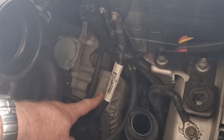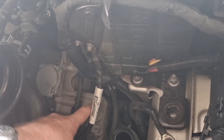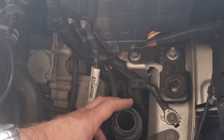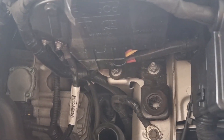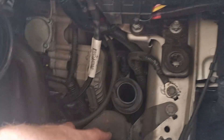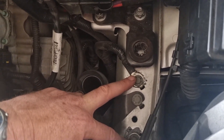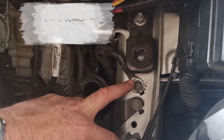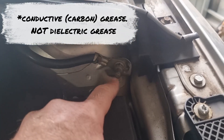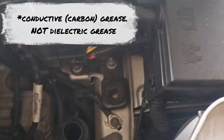This is the TCM here. There's a 10mm bolt there and the equivalent underneath as well, but there is a bit of a tricky plug on here. This is a resonator that belongs with the airbox. While we're under here, note these two earth straps — I've had these off and I've cleaned the paint off from underneath and put some conductive grease under there. Take the paint off, apply conductive grease to improve the earthing of the vehicle.